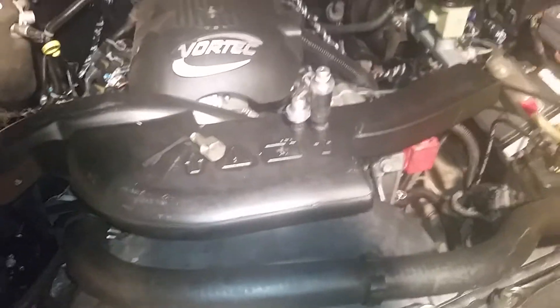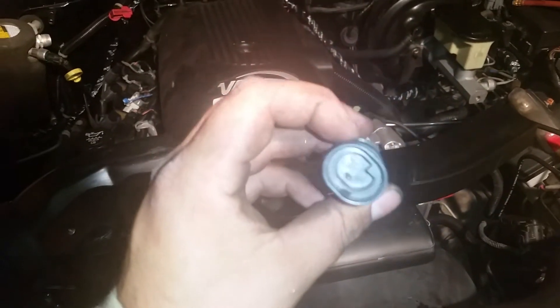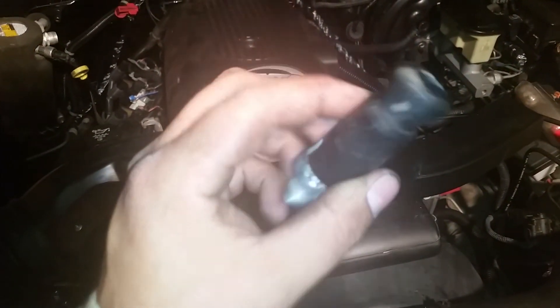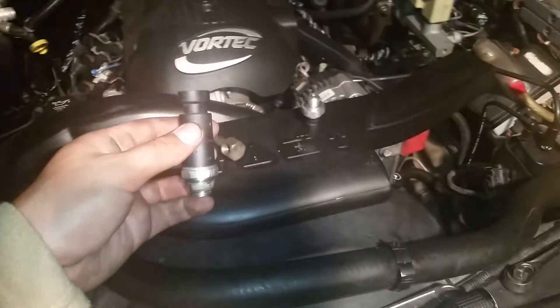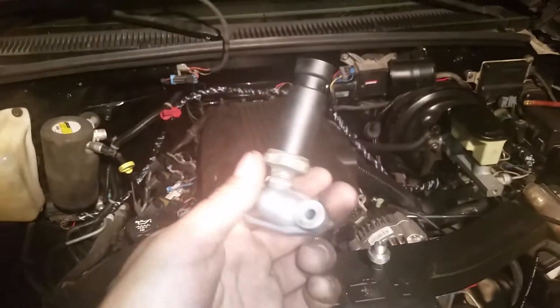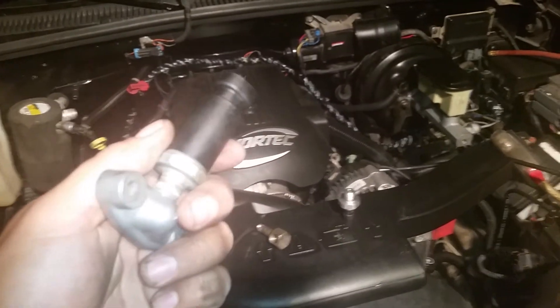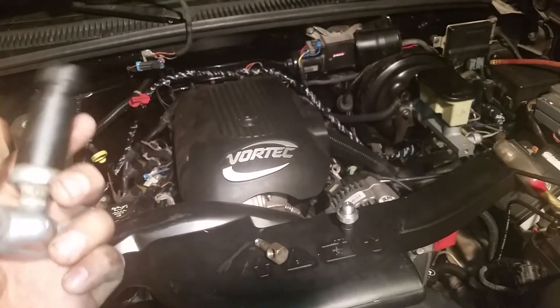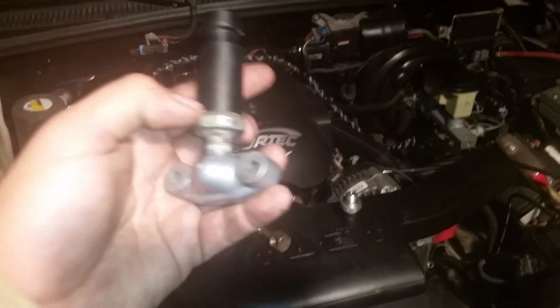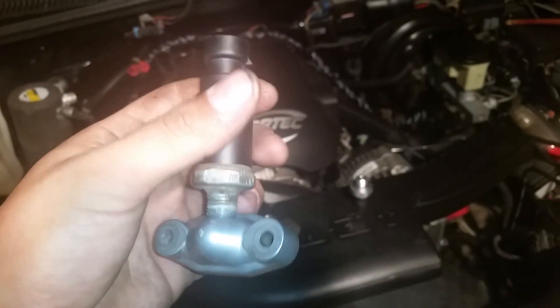You can see the wiring goes right in there, and that's going to drive your gauge on your dash. This one has the same type of plug but there are going to be some different values on the internal portion of it. I wouldn't suggest using this one — I'd definitely point you guys in the direction of using your original sender so that everything on the gauge stays constant and accurate, and you don't have to modify anything to get it to work properly. Pretty straightforward, guys — good luck.